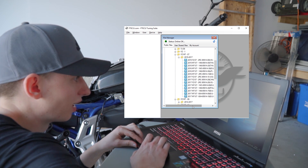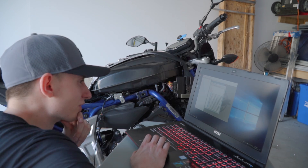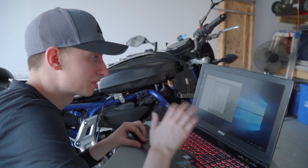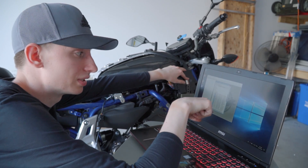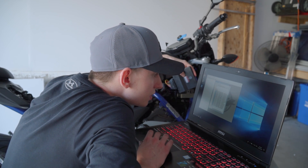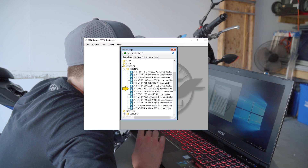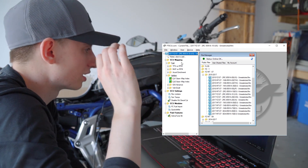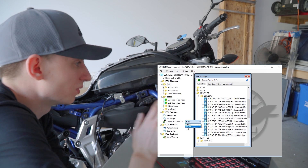Now this is my problem — I have a 2016 Canadian version of the FZ07 and it's not showing in the list. Should I risk it or should I call the company? There will be a bunch of ECU maps specifically made for different ECUs for the FZ07. There's a sticker on the ECU — just match it to one of these in the list. Mine says TOURC8591, which matches the 2017 FZ07 US version, so that's the one I'm going to use.